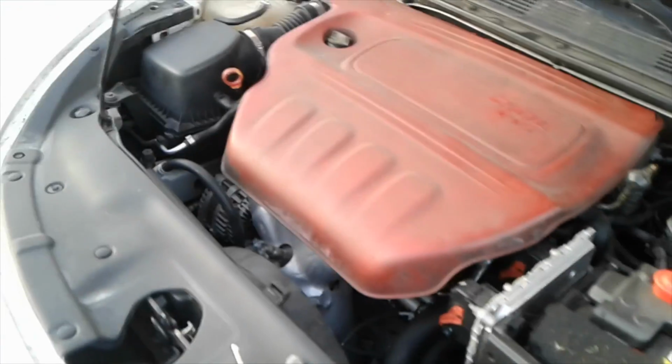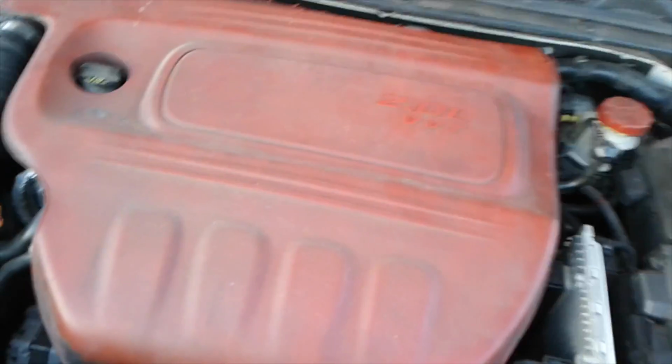See, you don't hear no hesitation. Once you crank it up and you hear it sputtering and jumping, that means your plug is loose. So like I say, I know what I've been doing for years. This is how you change the spark plugs on your Dodge Dart. Simple and easy. Without the camera and video editing, it takes about 10 minutes to do 4 plugs. That's it. But man, no hesitation to it.